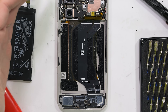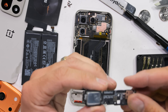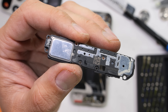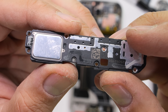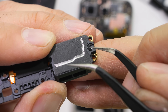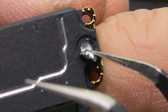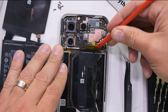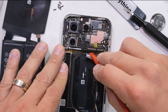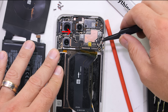Under the battery we get our first look at that hand-tearable vapor chamber, though it's still pinned under the rest of the components. The lower loudspeaker comes out next — it has a little sticker covering the trap door which reveals the OnePlus 15 does have balls inside, and plenty of them. Moving up to the motherboard, I'll unplug two long extension ribbons and two wire signal cables, plus a singular black screw in the center holding the whole thing down.